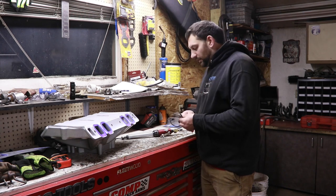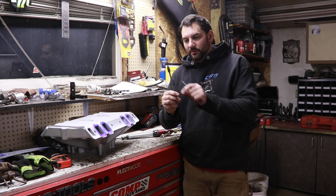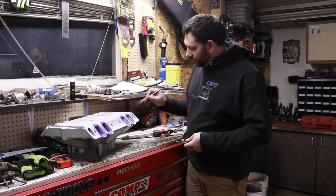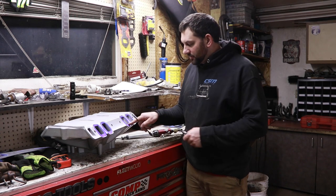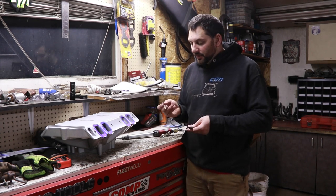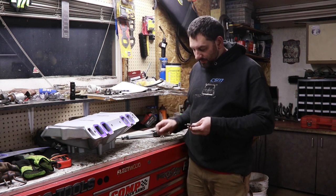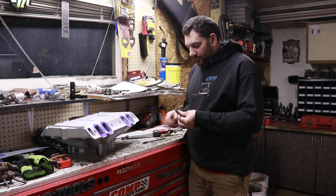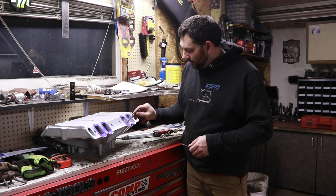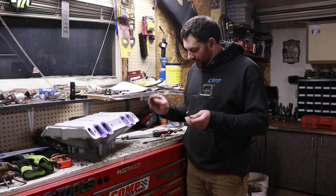I will use this large oval, I think this is a flame shape cutter, to rough a lot of it in, especially this roof area, because I gotta dig it down, but I also wanna keep it quite flat. So this'll be able to cut and keep a fairly flat shape as it goes. After that, I may switch to this oval, depending on how I need to go with the corners or just how things happen to fit in there.